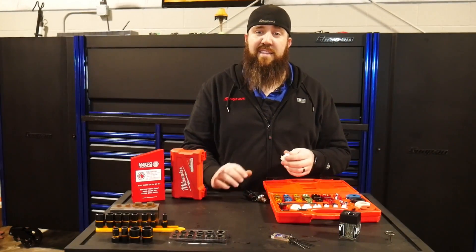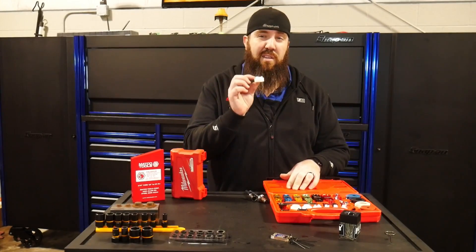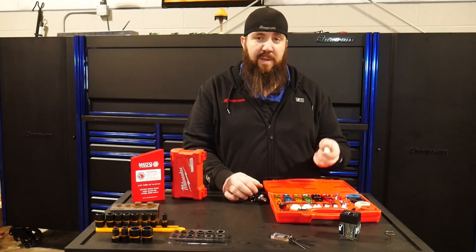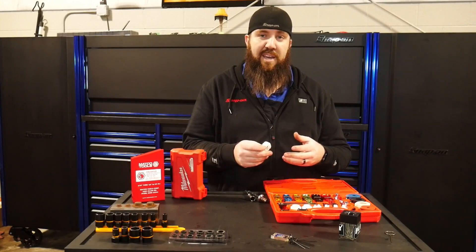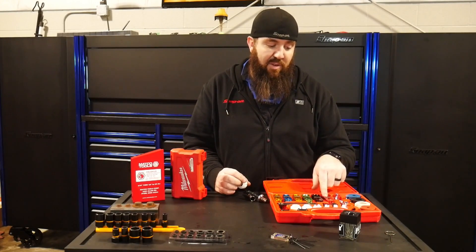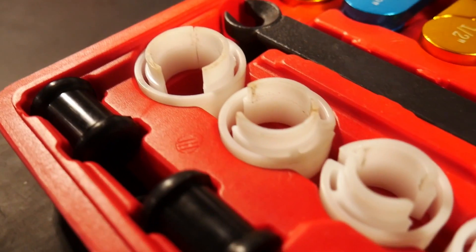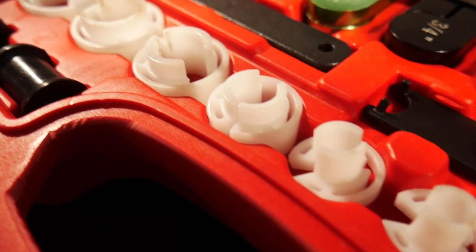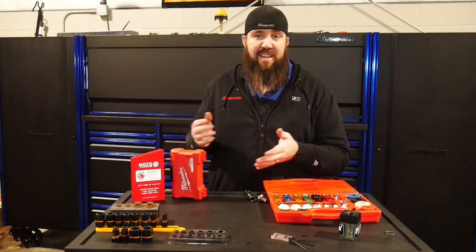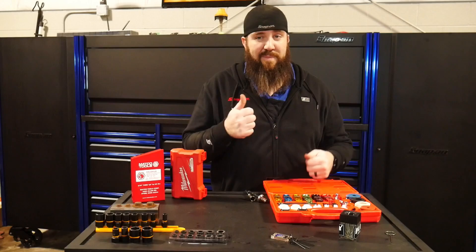The only negative side to this kit that I found is that the collet on the ends of the plastic retainer removers is a little bit on the short side, so if you have a deeper fitting — some of the AC fittings have a deeper collet — they're a little bit harder to get in and may not be deep enough. The aluminum anodized ones or the clamp-on fittings are a little bit deeper and actually get the job done. But for the cost difference between $32 and $239 for the Snap-on or Bluepoint one, there's not really much comparison. This one gets the thumbs up in my book.